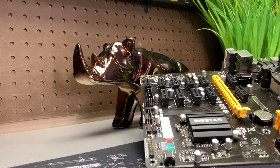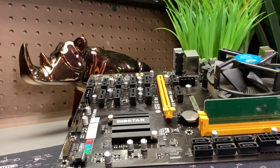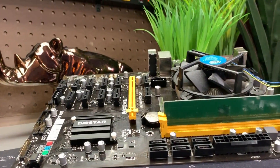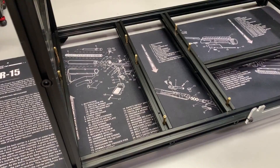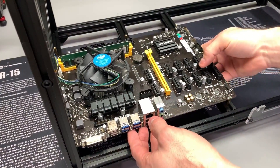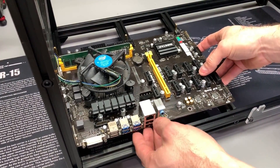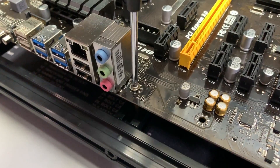Next we'll install the motherboard. For our rig we're using this Biostar TB250, but you can use other types like the Z170A series. Some motherboards are better for mining, and you should check to see if yours is capable of running as many GPUs as you want to use. If you're building a rig for mining, I recommend using mining-specific motherboards, as they're often cheaper. Install the motherboard oriented correctly on the standoffs.